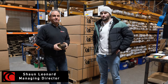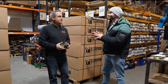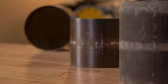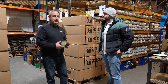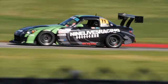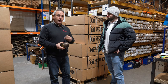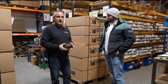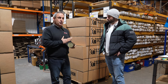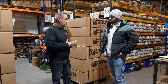We've got the man in charge to talk to us about the difference between 100 cell and 200 cell. Should I get 100, should I have 200, or just keep the regular cat? Well, it depends on the application and tune of the vehicle. If it's a track-based car, I would definitely say 100 cell — that allows a lot more flow and a lot more power through the exhaust system. If it's a road-going car, definitely a 200 cell catalyst — it gives a wide range of performance options, but it will pass a UK MOT.